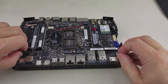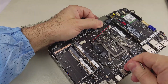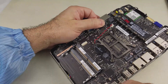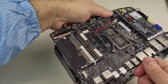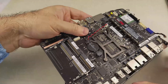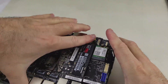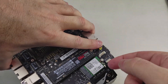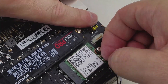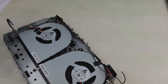Grabbing the blower connectors as far down as I can, getting those out of the way — there's one and two. Now it comes straight up. I also forgot the antenna connectors — use a flat blade or fingernails to pop those straight up; don't angle them off, you have to pop them straight up. Get the antennas out of the way and we're clear.